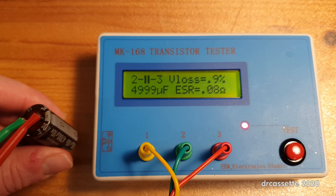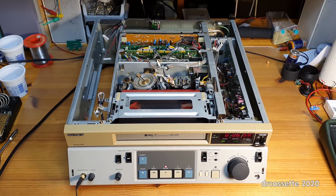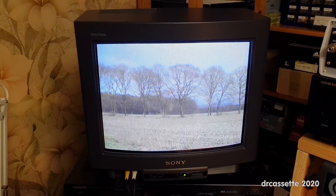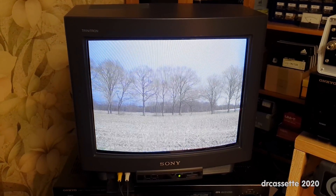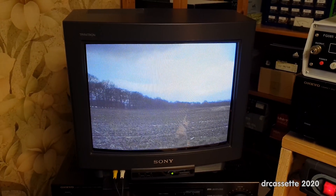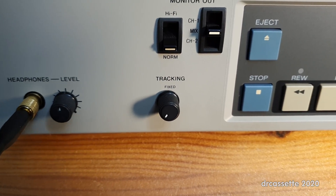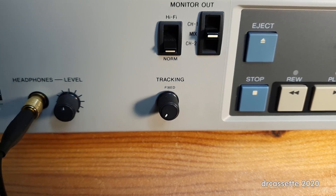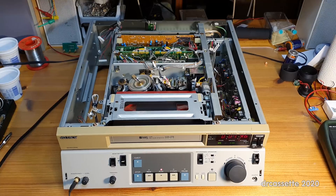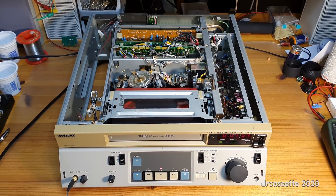Here is the Sony SVP9020 with repaired power supply playing back a Super VHS videocassette, and it is outputting quite a good picture. Though this might require some further experimentation — I tried various different cassettes and found that the tracking adjustment is really quite important. This is one of the shortcomings of this video player: it doesn't have auto tracking. And what definitely is still a problem is I still can't get the hi-fi audio to work — there is just silence. So this is going to require some more work, but we'll do that in another video.